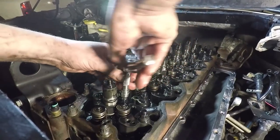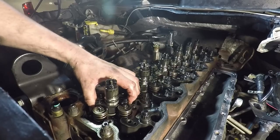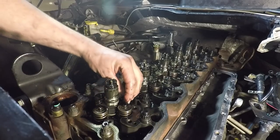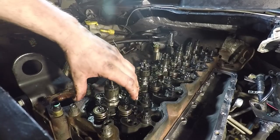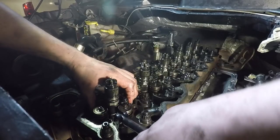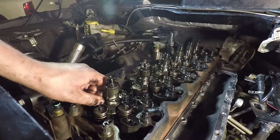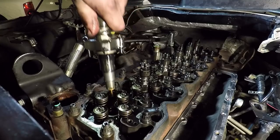Now we're going to pull the injectors. We're going to undo our clamp bolts — I already started this one. We're just going to pull them out so we have some play. The bolt is still holding this retainer. We're going to actually have to pop the injector out because it has O-rings in there — we'll put a little pry bar down here to pull it out, which keeps us from losing the injector and it flying off. It's a lot safer to do it this way. Get the pry bar in there — all right, now our injector is free. I do that just to be cautious; I don't want to throw the injector off the side of the truck if it's really stuck in there. And there's our injector.